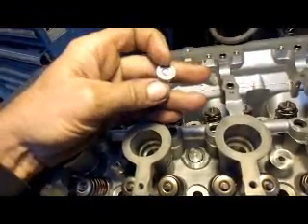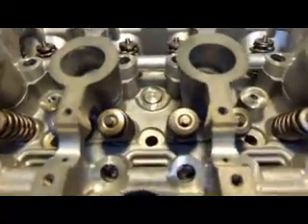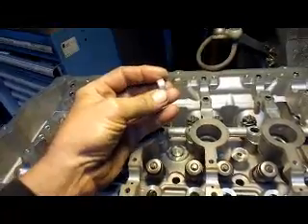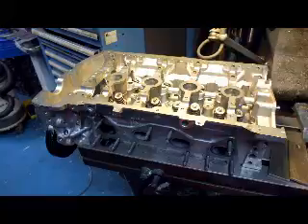This is the original freeze plug, but when we went to put it in it actually dropped down the hole, so I had to make one up out of aluminum and press it in. Just a word to the wise — I don't know if they're gonna be able to find an 18 millimeter core plug, maybe. But if you don't, you're gonna have to make something up. Anyway, that's it on the new Mini heads — we'll see you later.